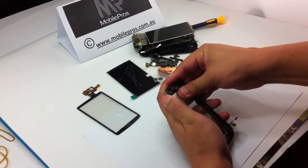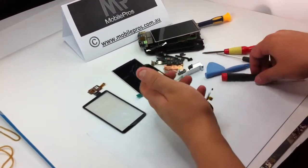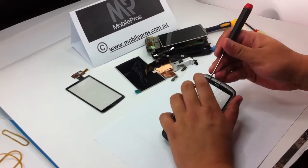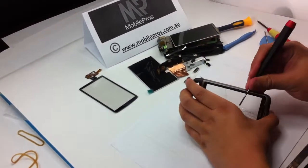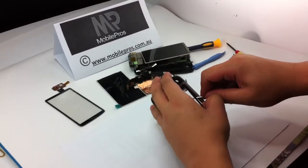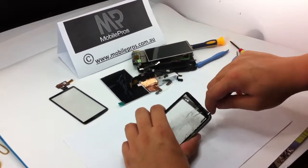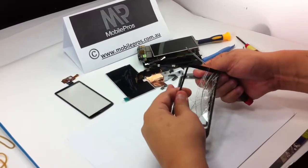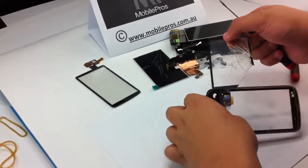We have actually already loosened it before. So be careful — use your hand to press outwards on the digitizer to leave a gap, and use the opening tool or the flat screwdriver to open from the front. Be careful, this is pure glass so you may hurt your fingers — make sure your fingers are not hurt. After you take off the digitizer, take off the cables from the little hole on the frame.